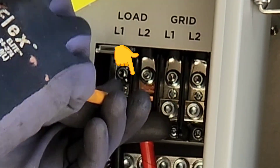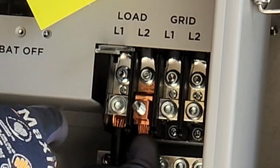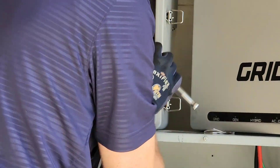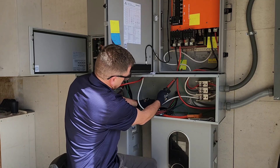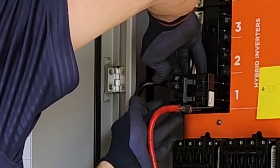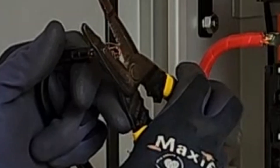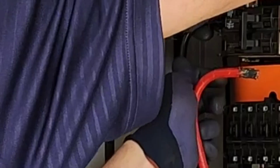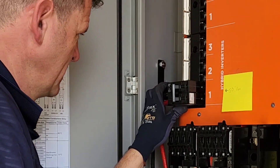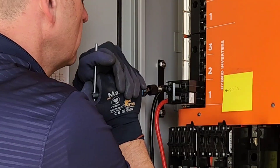I had to use this adapter earlier when I installed this Flex Boss because I over-torqued this hex nut and broke it — I need to get it replaced but haven't got around to it yet. Those should be long enough, L1 on top and L2 on the bottom. Not quite seating as deep — I'll cut this flush. Oh yeah, that's way better. It's kind of tricky to get these up to torque specs because once you torque it, if you move the wires around you can get a few more turns in.